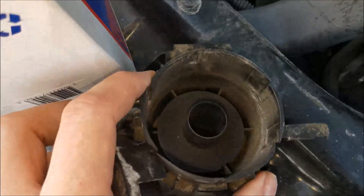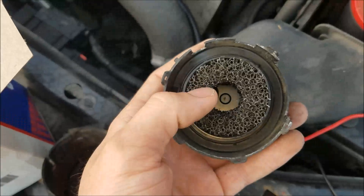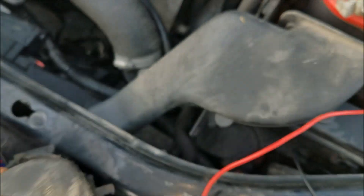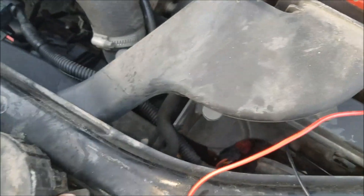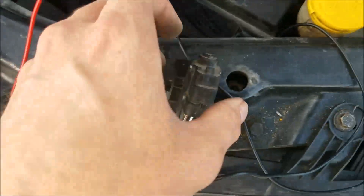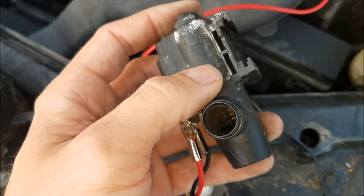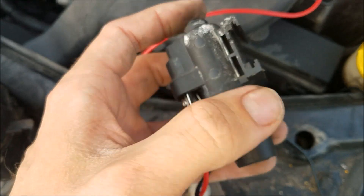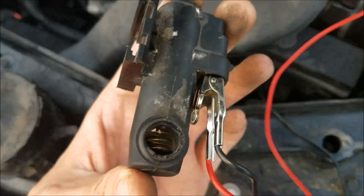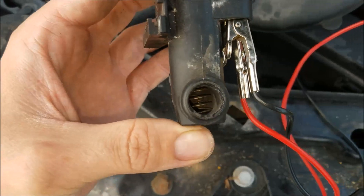Here's what they look like on the inside. There's a little filter — what it does is filter particulates from getting inside the system. However, it doesn't stop moisture. So what ends up happening is the actual valve portion will freeze up on the inside, because moisture gets in there and, given the location underneath the car, it just freezes up.